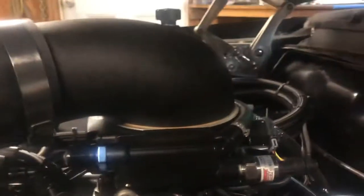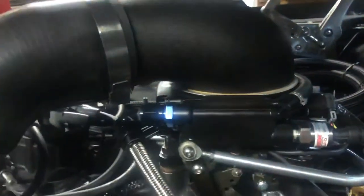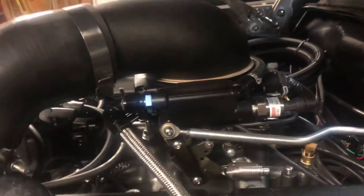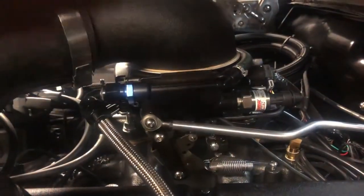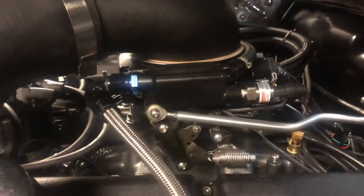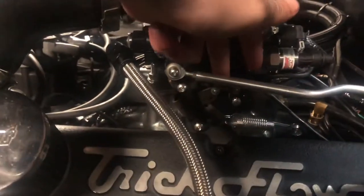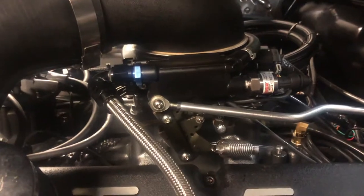These Snipers come with a throttle linkage bar — just like a carburetor for secondaries, except it's a one-to-one ratio. That means if you have a peppy motor and you crack the throttle, you get bucking — the primary and secondary both open at once and you lurch forward. Things you can do to fix that: buy a progressive linkage. You can buy the little cheap non-adjustable one for $10 to $20, or I bought this adjustable stainless unit that lets me thread and adjust when the secondaries kick in. I have it adjusted out to where the secondaries open at maybe 50% or more.